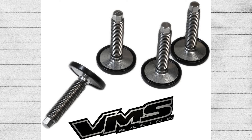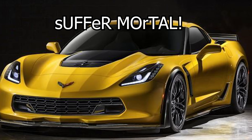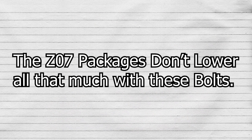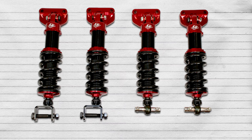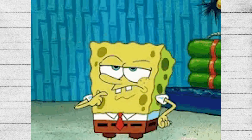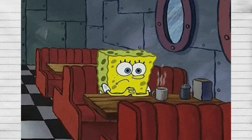You can find cheap ones off eBay for $60–$80, but they're going to start squeaking or even snap, and that's not something you want to deal with. If you have a Z06 C7 Z07 package, lowering bolts don't really do anything — I later read a forum where people said the Z07 packages do not lower with lowering bolts, and if they do, they ride terribly, which I can confirm. For the Z07 packages, you'll have to buy drop spindles. Getting on bags isn't really an option either because you'd have to basically replace your entire leaf spring assembly, since most bag systems are designed for coil/strut designs. So I'm just going to go drop spindles and deal with the flat drop that it gives me — just live that static life.